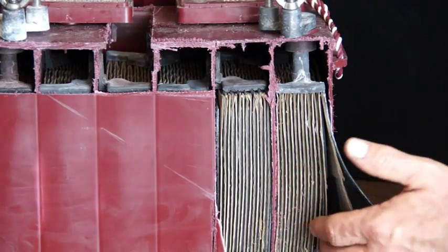These batteries generally come in two construction methods: starting and deep cycle. The starting battery has many more thinner plates, so the chemistry reacts quicker when we demand high starting current. Deep cycle batteries have a more rugged, stronger construction, because when they're deeply discharged, the lead gets weak and we could have shedding plates. On a large cruising boat, we could have a dedicated starting battery for the engine or emergencies, and a specific house bank, as long as they're kept isolated.